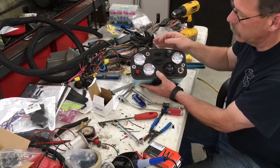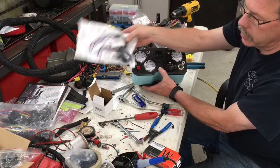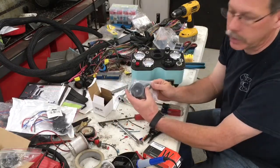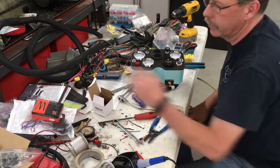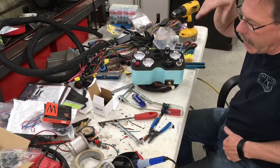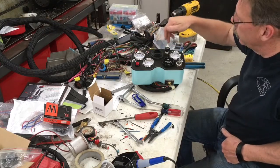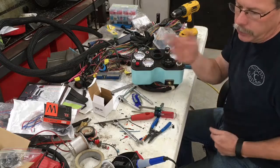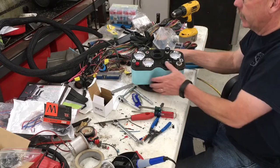The headlight switch and the horn switch will both control just a weatherproof relay, and I'll mount those down on the body somewhere, then mount my little horn. There's actually a stock horn in there, and I'm going to test it and see if it works, but if not, I've got a little motorcycle horn — just for safety if people are moving around or working around you. I've got some LED lights I'm going to control with this, probably mostly having them off the back but may add a couple to the front as well. As long as I keep it all LED, the 10-amp fuse is essentially the switch to the relay, and the rest of the circuit will be fused off of the main power coming off the battery and alternator.